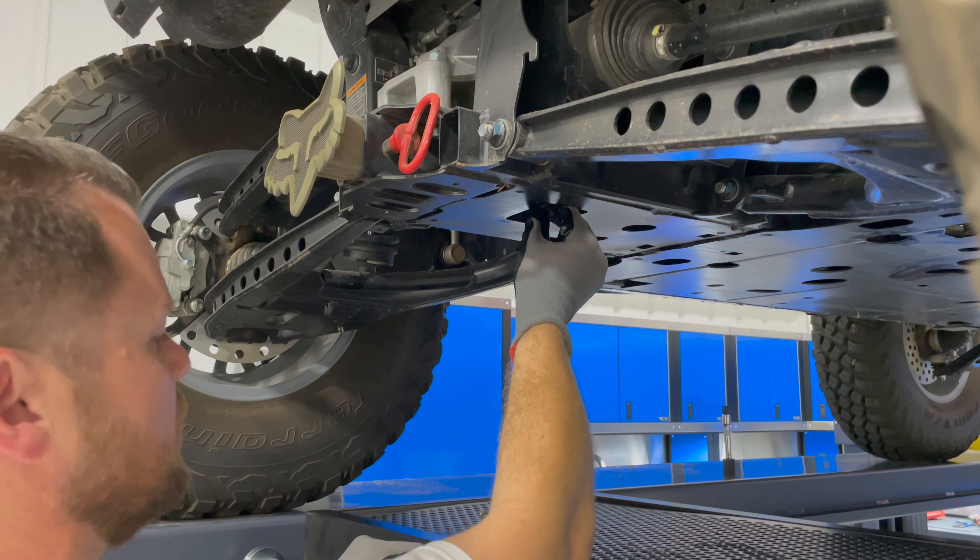Alright, so it's drained and I cleaned up my drain bolt with some carb cleaner. Also don't forget there is a small washer on that drain bolt. You torque to 20 newton meters, and I have a small torque wrench with an adapter that barely fits in there.